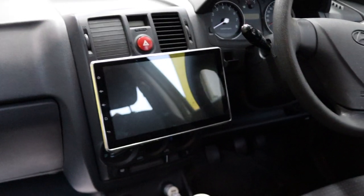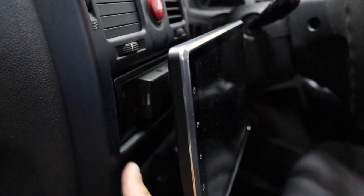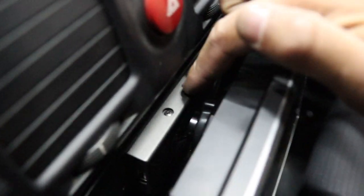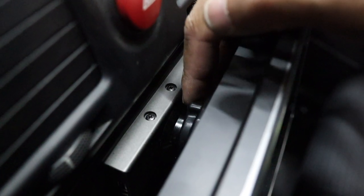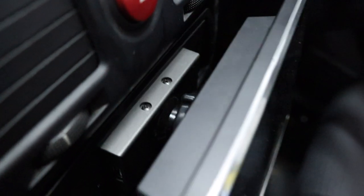I'll show you a couple of things I was worried about and how it's mounted. It's so big. You can see we've got the single-din right here — I was able to get the trim ring around it as well and it's mounted, not going anywhere. Once your single-din is mounted, this screen slides on right here — there's a little square that slides in, two screws line up, pop them in, and one at the bottom as well.